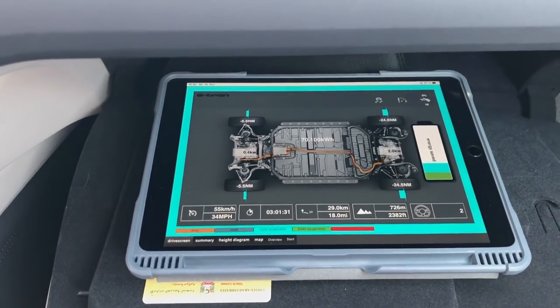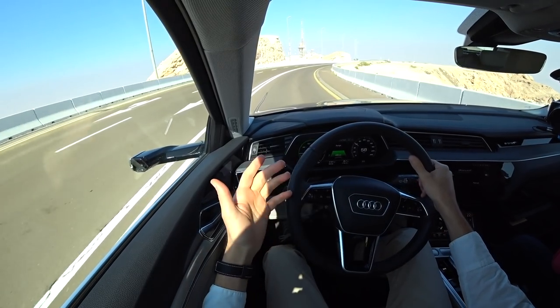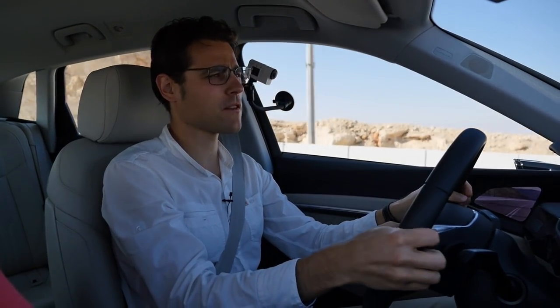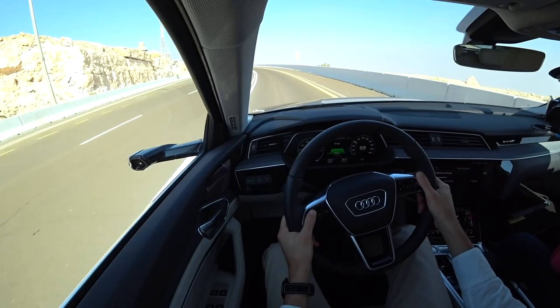Lift the throttle, I'm coasting again. You could argue for the automatic mode, for example, when you're on the motorway, that coasting is more suitable somehow, and then you use the brake. Again, if you want always the one pedal feeling without having to change it again, then this manual recuperation mode would be the way to go.